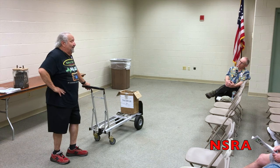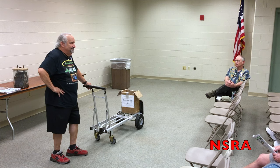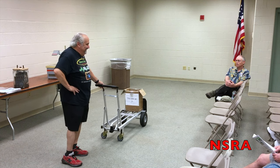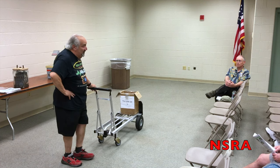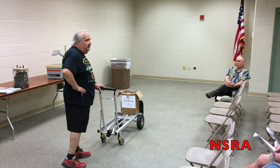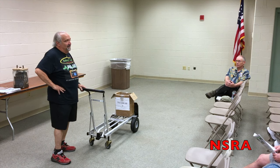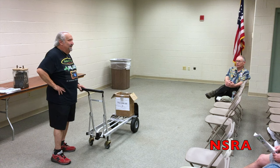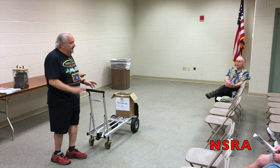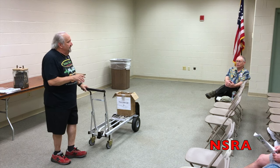The other thing is, you don't have to worry about sticking a battery on a concrete floor. That's an old wives' tale from years ago. That came from when batteries had rubber cases. Well, before rubber, when they were made out of wood. The first batteries, before they even went to glass, were made out of wood. I happen to have a collection of vintage battery chargers and a few batteries, and I have one wood one. They put tar inside in order to insulate the cells.